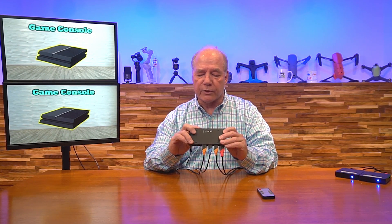Now let me switch one of them to input number two by tapping this button on the front. It'll take a second as it adjusts for the resolution change. And there you go — there's the video. Now if I want the second monitor to show the video as well, I can tap that button. It makes the adjustment, and there's the video on the top monitor. So what the matrix does, unlike a switch, is give you complete control over which input is sent to which output at any given time. You can send the same input to both monitors, or split it — one media player to one monitor, the other to the second. It gives you a lot of flexibility in how content is distributed to your output devices.